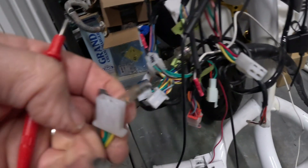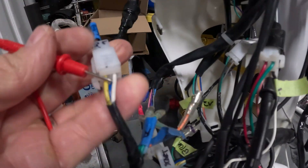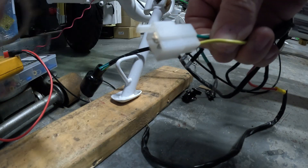It'll look like that, and I've only altered the switch wire — that can be replaced. Nothing's altered on the regular wires. If you want to go back to normal, this won't be fed power until that switch is on. Now every one of these yellow wires that used to be AC is now connected to that black wire, and all the black wires that used to be DC are still DC. This is the one that goes to the tail light when the running lights are on — that's now DC 12 volts. And the yellow wire going to the headlight is now 12-volt DC.